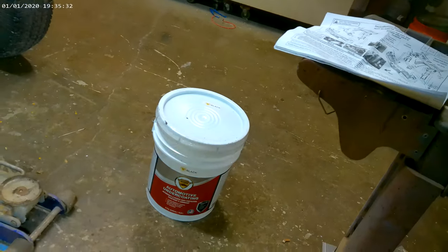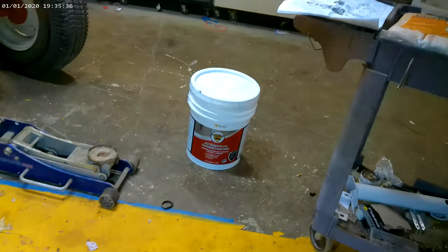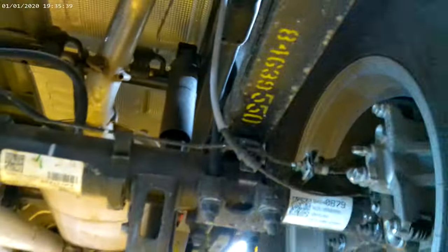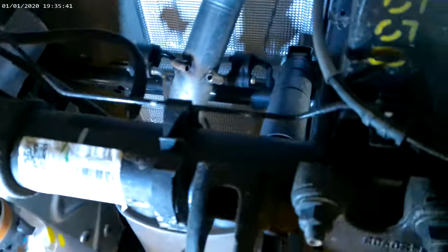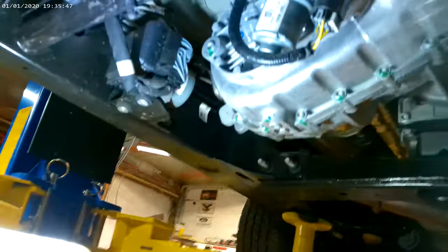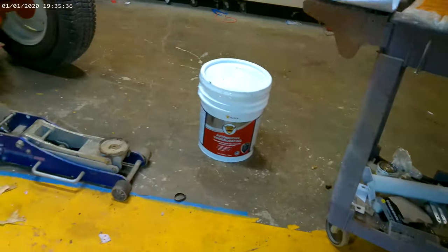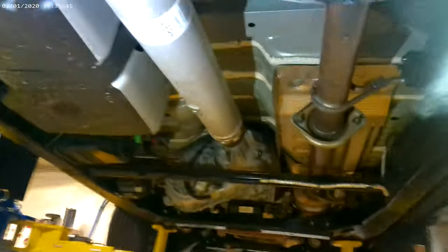Here's the stuff I'm gonna use — I like this stuff. It's wool wax; it doesn't get hard and trap water underneath, so it does a pretty good job. I've been using this for quite a while. I've used the thick undercoat all the way back to the 70s and I've trapped moisture under it and caused rust, screwed up some pretty good cars, so I definitely know how not to do it.